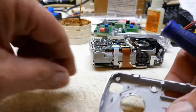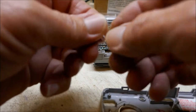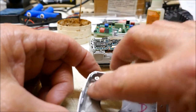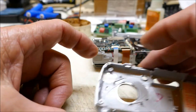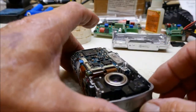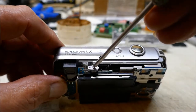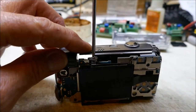All that's out. Be aware that your little lens that sits up in the corner is going to fall out, so I normally just glue that back in place so it doesn't get lost. Now to do the hack on our camera, we need to access our power and shutter board up top. There's one screw right here that we need to remove.